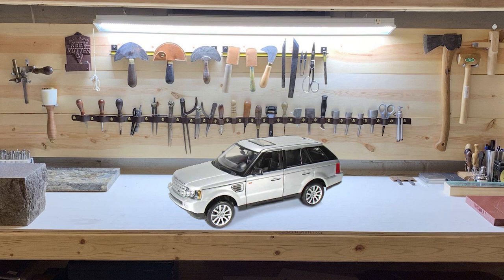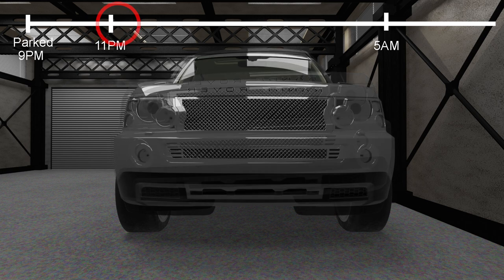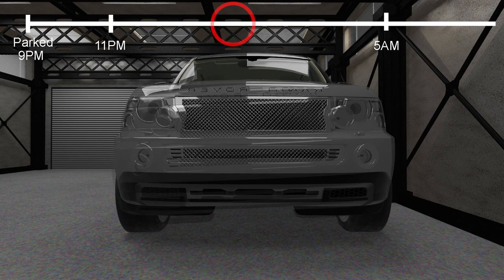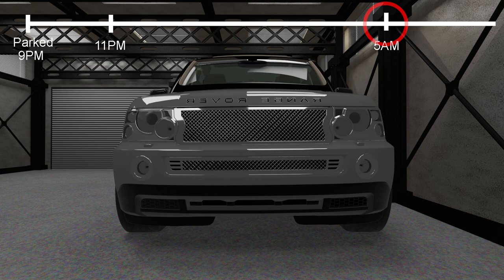The biggest issue is that if there is a leak, it's difficult to find because the vehicle readjusts its height throughout the night. When the vehicle is parked, the air suspension module wakes up two hours after the ignition was last switched off, and then every six hours after that. The vehicle height is checked at that time, and if not level within a preset tolerance, small downward-only height adjustments may be made automatically. This creates a problem because if the front right air spring is leaking, you may see the entire front end or the entire vehicle sagging rather than just the front right, as the vehicle is attempting to level all night.